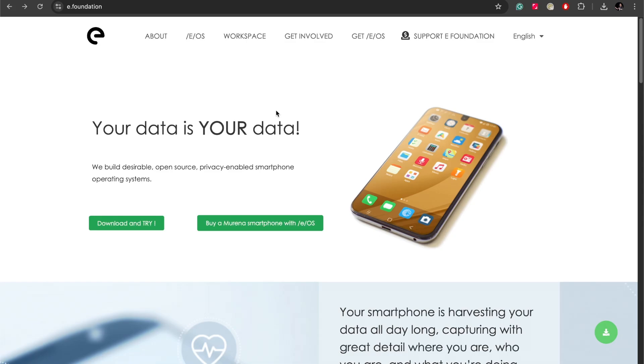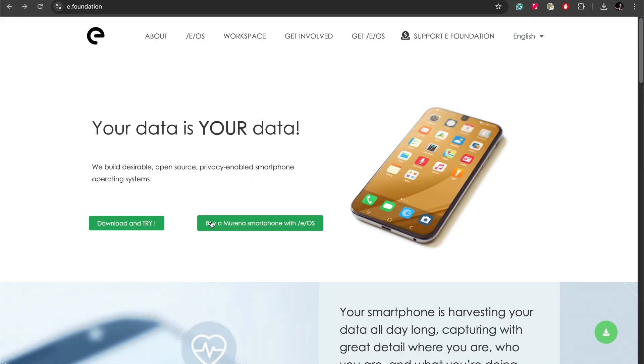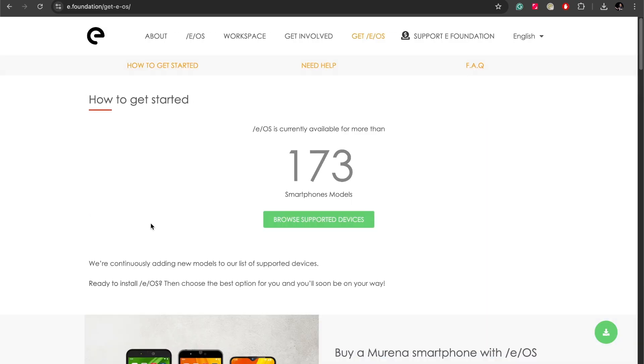So let's head over to the website and take a look at the install process. Popping over to the eFoundation website, this is where you'll find all the downloads for all the different devices they support. You can also go from here to the Murena store to buy pre-loaded phones if you don't want to flash your own. It's not a huge process depending on the device, but there is some risk involved and you do need to know your way around some commands, so I completely understand why some people will just want to buy a pre-loaded phone. Plus sometimes they have good deals on phones as well. Today the CMF Phone 1 isn't available for purchase yet — it is up for pre-order at the time of recording — but we're going to download for our device, and as you can see they already support a huge range of phones.